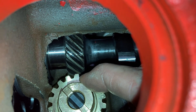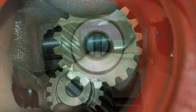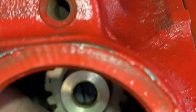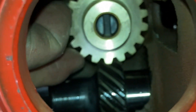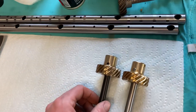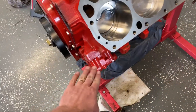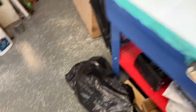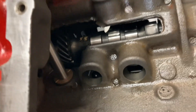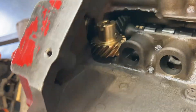Watch your slack. Seems like a lot. Milodon. That gave me a little cause for concern there. I'm glad I had both of these to compare. Maybe it was because the oil pump was not mounted up in that other video. So I will drop in this 440 shaft — this is totally bone dry. I realize oil does take up a little bit of slack and all that.